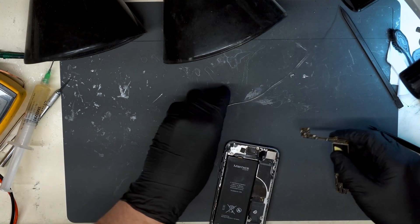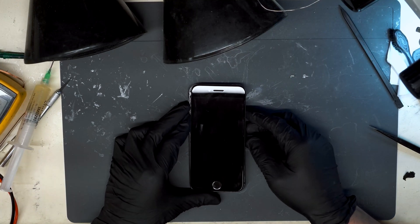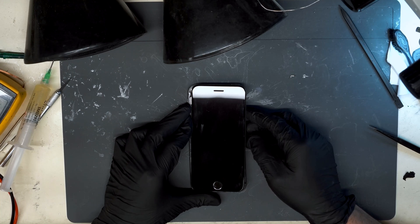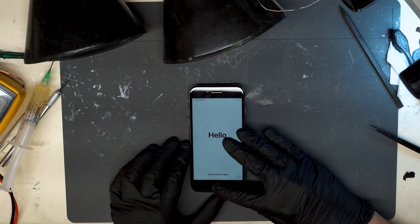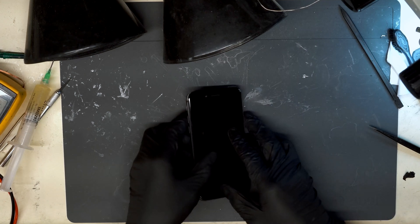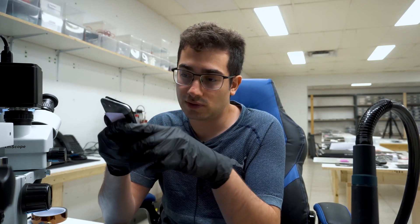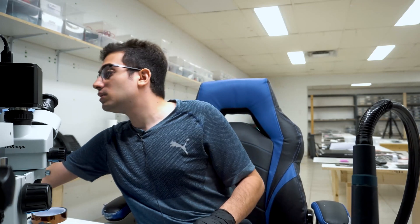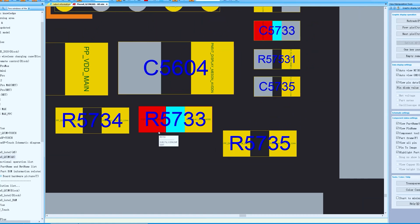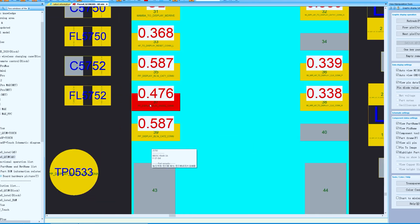We have a normal diode mode reading now. Switching to the overhead view — grabbing the customer board and prompting to boot. You can see the backlight has been restored. As a recap: this phone came in for a screen repair, but our technicians noticed water damage. After installing the new screen there was no backlight. It ended up being a faulty resistor from water damage and corrosion — R5733. We found it by using diode mode on the LCD connector and finding an open line reading on pin 37. We'll finish testing, get it assembled, and get it back to the customer.